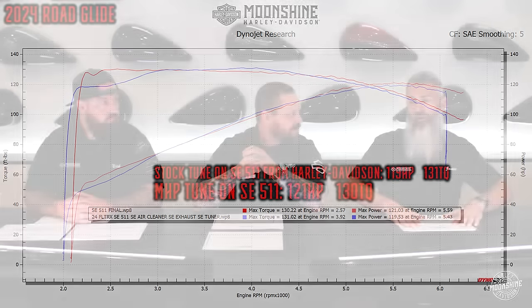The Wood Performance 22XE made 127 horsepower and 133 torque. The final cam was another MHP — the 492 — which made 131 torque and 134 horsepower. We threw that one in because higher lift cams are going to be the future of these engines with this design. The Screaming Eagle is a 511 lift. The MHP 492 name is a little deceiving — the 492 is the exhaust lift, but the intake lift on that cam is actually a 522. This new head design and intake path wants a little more lift and can handle it on a stock head.